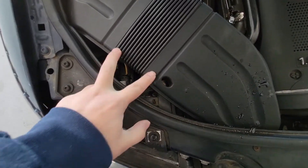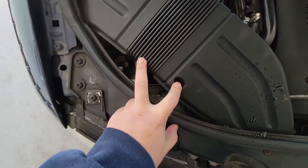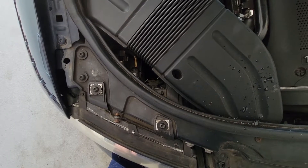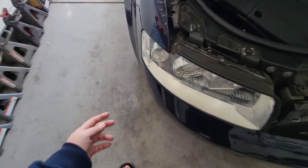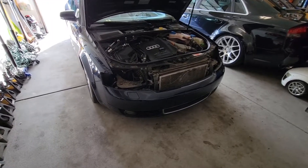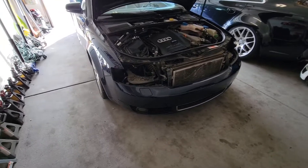Also T30 — and those back two, all you need to do is unscrew them ever so slightly so that the headlight can just slide out. Let me go ahead and get both sides of these headlights out and show you the nuts that hold that portion of the bumper in. Since the headlights are out now, let me show you all of the bolts and nuts that need to be removed to take off the front bumper.